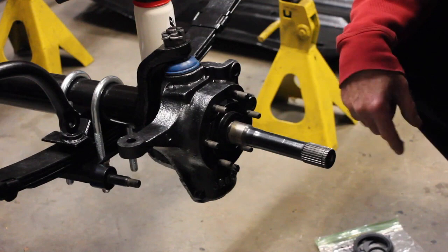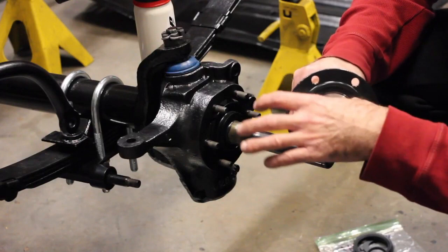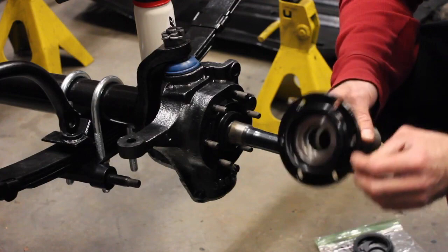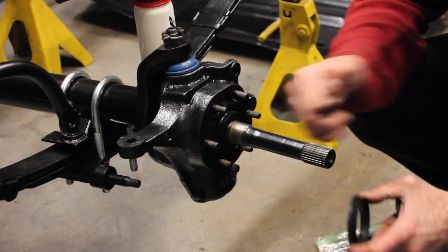Now I'm going to put on the wheel spindle. It consists of really five things. There is an inner needle bearing that gets seated into the spindle — mine's still in really good shape so I didn't replace it, no wear on it. I powder coated the outside of the spindle to prevent rust. Then there are three pieces that are oil seals that go on before we put the spindle on.